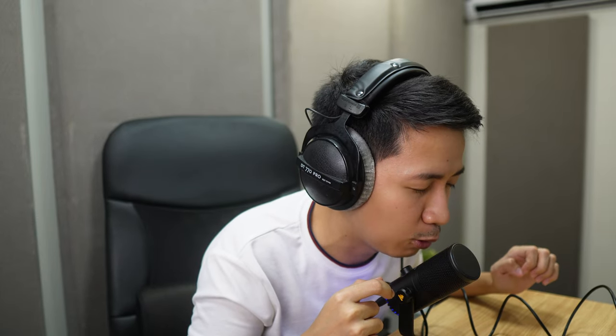And when you're done, just long-press it again. Something peculiar about this microphone: when you get up close and use a high-pitched voice like mine, the audio isn't clipping, but it does sound distorted. But here's what I discovered — if I try to do a deep trailer voice, it actually works. You can go low on the bassy side, but if there's a lot of treble in your voice, you're gonna have to step back or use it the way it's designed, which is to speak from afar.